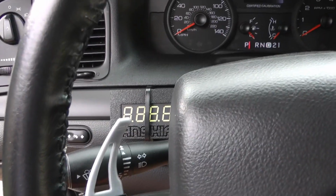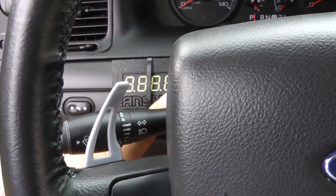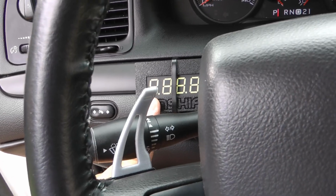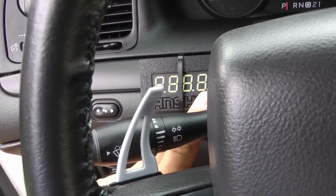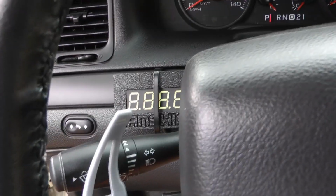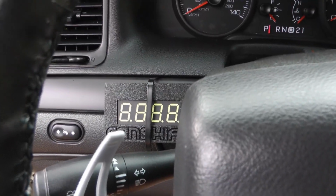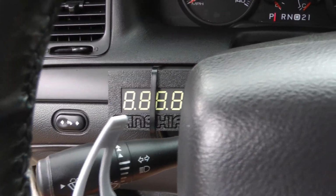From the driver standpoint, that's about the view you're going to have. And so I think this one shows the actual gear that the car is in, and then when you're in Canshift mode, this will show the gear that you've selected. And the reason there's 2 is because you may shift into second, but there's a delay before it shifts into second and third and so on, or back down as well. Now I haven't tried to do anything stupid like put it in 4th gear from a stop and see what it does, but I have a feeling that it's gonna make it go into 1st when you're stopped rather than let you tear up your transmission.